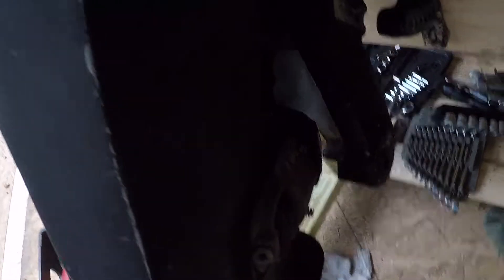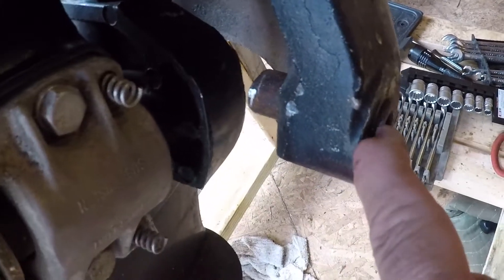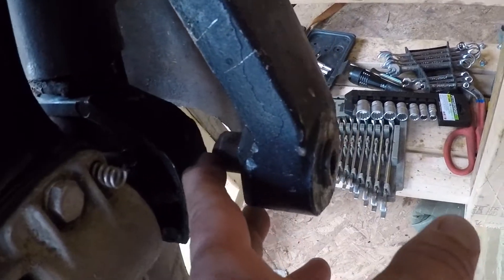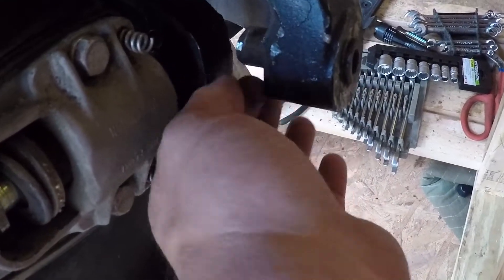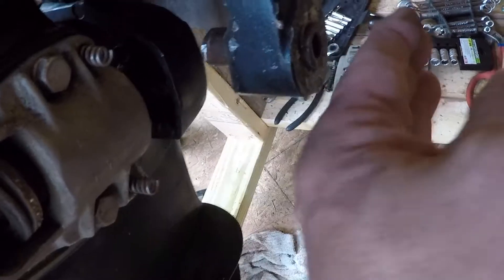I have another midsection that I'm going to use because one of the things was this pin right here, and there were a couple of ways to approach that. I tried to beat it in and it didn't want to go — it got to a certain point and then it just wouldn't. So most likely this shaft is burred somewhere. In retrospect, I probably should have taken my Dremel or some sandpaper and gone around the shaft, then beat it back in, working it with some oil until eventually it would go back into place.